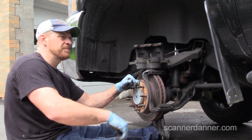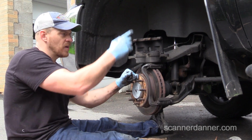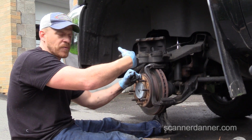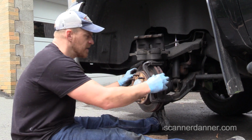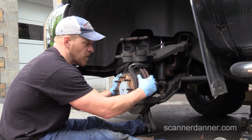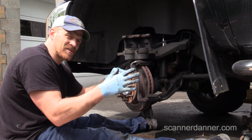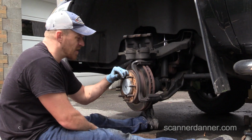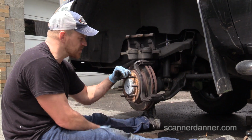You, the customer, go to a garage and you have a right rear caliper and a left front caliper replaced. This needs front pads. So now you're going to do front pads, and then you've got to consider the rotors. Now these were changed last year, but there's already a ridge on them. So now you're talking, as a need for this particular vehicle, and everyone's going to be different on how you handle the rotors.